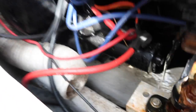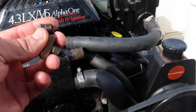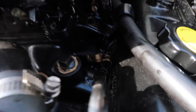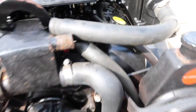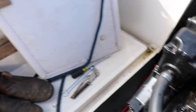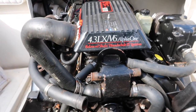Take your two block plugs and just set them in the intake manifold — that's what I do, they won't move out of there. Now we're going to get on to doing our antifreeze, so take your jug of antifreeze and we'll get to putting it in our hoses.